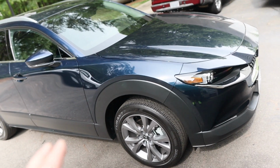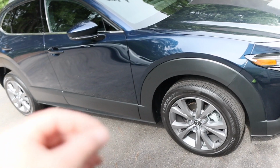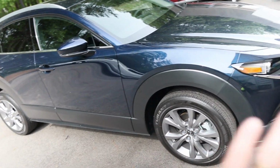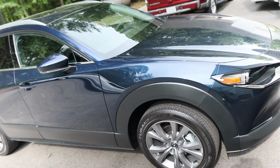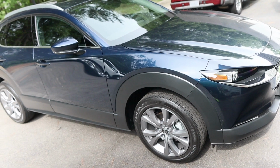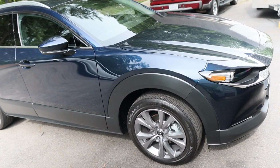On a cool vehicle, even if you're in the full sun, and on a relatively cool vehicle, you wanna rinse everything first. Use an APC. If you're gonna use Super Clean, something very strong or extra tough, dilute it appropriately. Usually 1 to 4 or more, but if you do 1 to 4 and you wet the vehicle, it's gonna dilute it even more once it hits the panel, and that's okay. But it's not gonna damage anything unless you just let it dry on there. You don't have to let it dwell for many, many minutes. 30 to 60 seconds is all it takes, and then rinse it off. So it's not gonna damage anything unless the vehicle already has previous damage. So assess the vehicle, make sure everything is good, and then you can go ahead and do your APC rinsing.